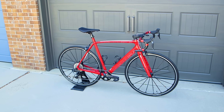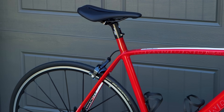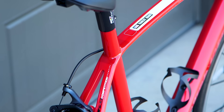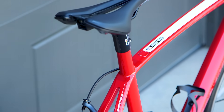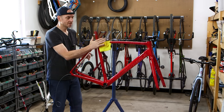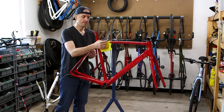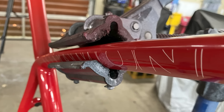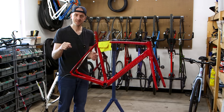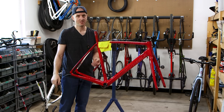Here's the final repair. I think it looks really nice — I think it looks like it came from the factory this way. If my paint color match had been a little bit better, I don't think anybody would know that this originally had a seat post and that the seat tube had cracked. You'll notice throughout the video I've got the bike in my park stand but it's not actually clamped. I've got the clamp down to keep it from falling out but there's about three millimeters of space between the clamp and the top tube — there is no clamping force. So if we see comments lecturing me about clamping carbon frames in a stand, we'll know they didn't watch this part of the video.